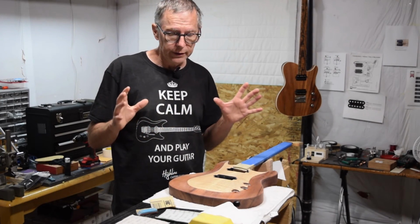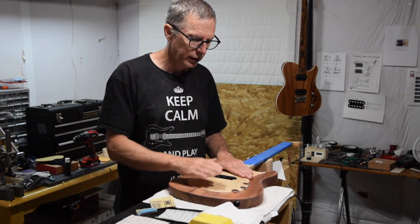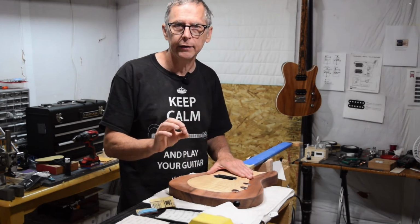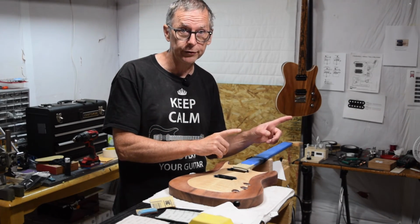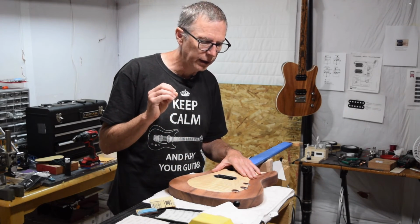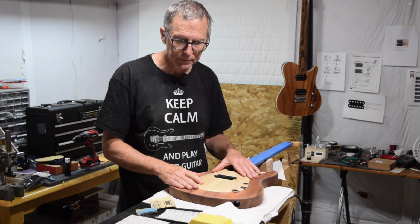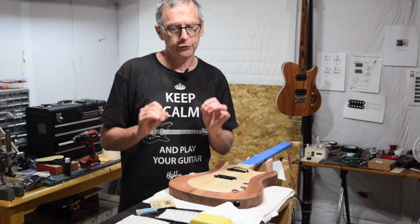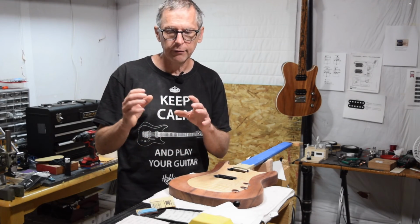Now that's basically the technique that I use for level sanding and polish sanding my clear coats prior to taking the guitar to the buffing machine. And I'll be talking about that in a future episode. I'll walk you through how I use my buffing machine and my Menzerna solid compounds to achieve a high gloss shine. But one thing I want to stress is this is sort of a new method for level